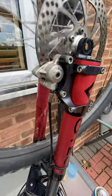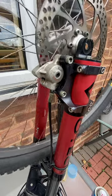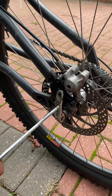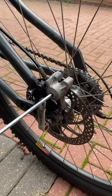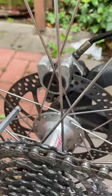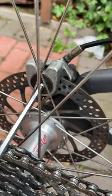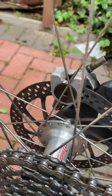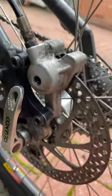It's spinning freely there and seems to be turning okay. Now I've got to adjust the caliper to reduce the brake lever travel - it's just a matter of adjusting these adjusters here, which brings the pads closer to the discs so there's less travel. With that, thanks for watching once again and please subscribe.